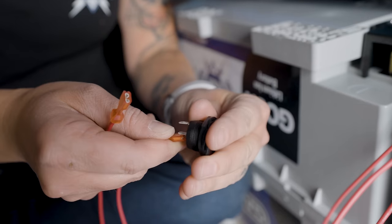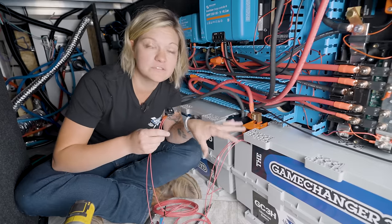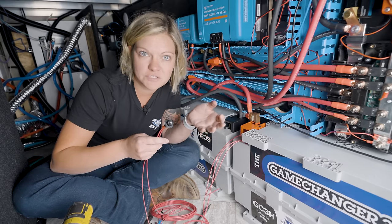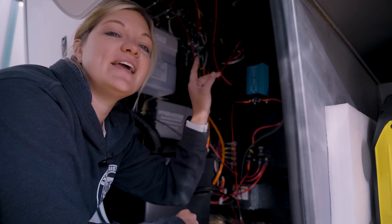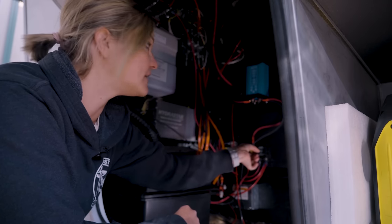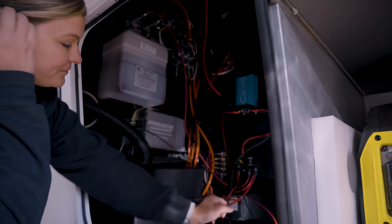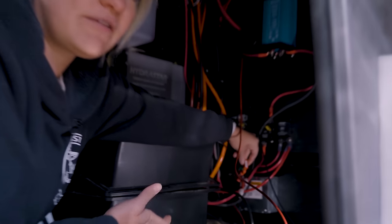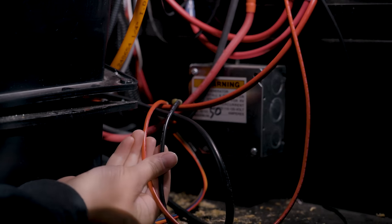Now we connect the two power wires to the switch for the battery heaters. This switch is controlling the thermostat internal to the batteries - not necessarily the heater itself - so the batteries actually have to get cold enough for that thermostat to kick on and kick the heater on. This camper came pre-wired from the factory for solar, which means there is a solar wire going from the roof all the way down to right here, which is where we're going to butt-splice in to connect to our solar isolator. We've already connected our wires to the solar isolator, so we just need to connect them here. This camper also already has an inline fuse here, but it's actually unnecessary because it's not protecting anything and it's not a high enough voltage, so we're just going to cut that out, splice into our wires, and then mount the solar panels on the roof.